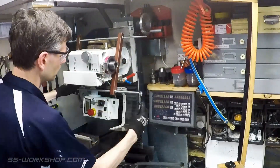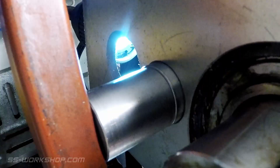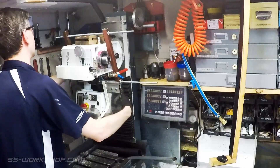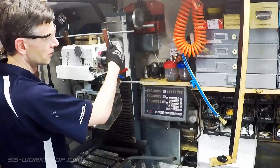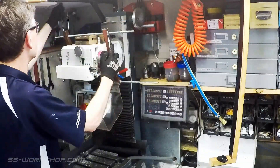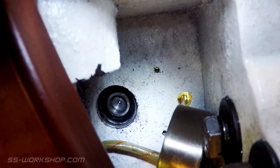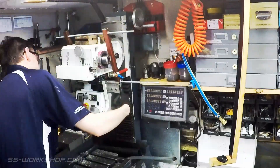At this point we also need the slug of steel turned to fit over the shaft and press the bearing back in. This will ensure a force is evenly applied to the bearing as it's pressed in. Now the nuts can be tightened, quietly pressing the shaft in. Here we can see the bottom bearing as it presses in. Continue to tighten the nuts until both the top and bottom bearings are fully seated.